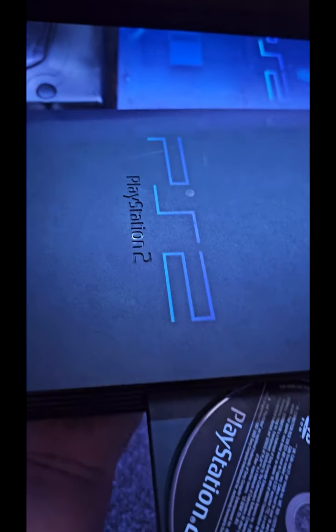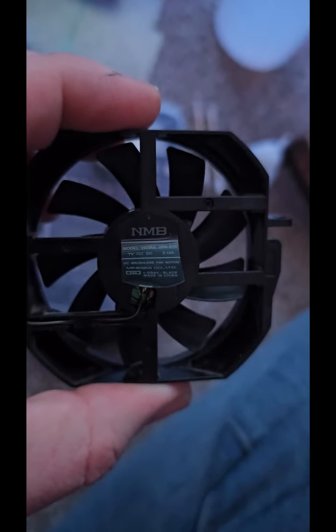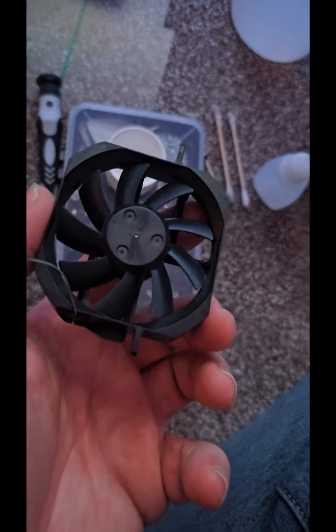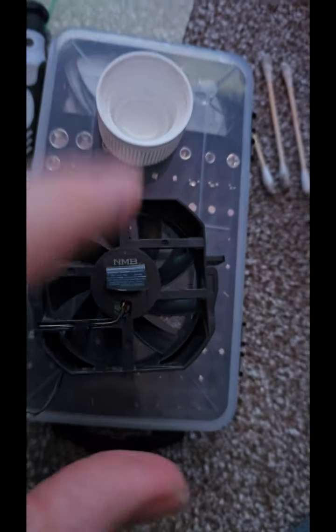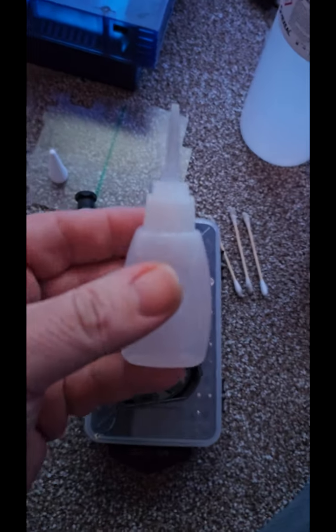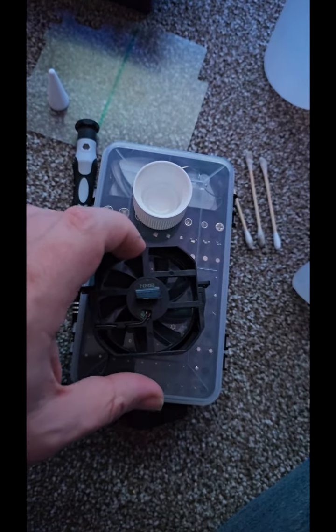That's crazy. I'm going to take that out and clean it up, and put it in that. This is the fan that came out of the 50,000 series. It says NMB — no idea, never heard of that. I'm sure the other one was a NIDEC fan. Excuse the dirt — it was pretty dirty. I used three swabs to clean this. What I would suggest, if you are swapping these fans: pop the sticker up. See that point in the middle? That's the bearings. Get yourself some oil — basically used for sewing machines and things — a couple of drops in there. It will lube it back up and keep it going for many more years without it drying out.